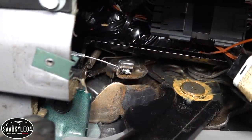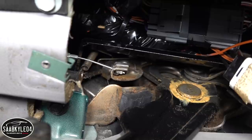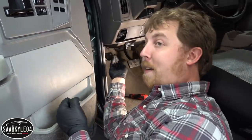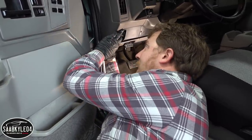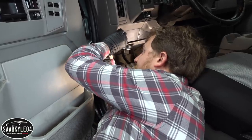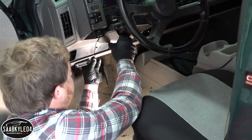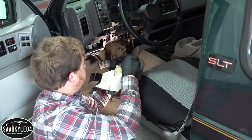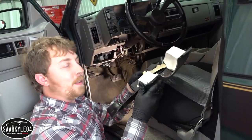This lever is attached to a cable with a little nut or stud at the end, looped into a hook on the parking brake bracket. When you push it in, it pulls the cable, pulls the bracket, and releases the lever. What you have to do is reach up inside and push that bracket towards the rear of the vehicle — that'll give enough slack to slip the cable over the retaining clip and it'll pop right out. Everything is free now, so all we have to do is pull the trim panel out. There should be a vent tube that connects there, but it's not connected, which probably explains why that lower vent wasn't producing air — so I can fix multiple problems here.